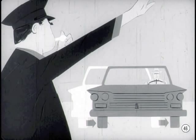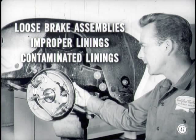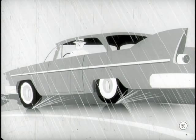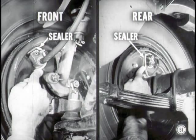Here's another condition that can fool you, and that is brake dive — a condition where the car will pull or dive to one side. First you'd naturally look for the usual causes, such as loose brake assemblies, improper linings, and linings that are contaminated by brake fluid or grease. But in addition, there are other conditions that cause diving, and they can be traced to loose or worn front suspension parts. Misalignment of the front suspension, such as improper caster and camber settings, can be contributing factors. There's also the possibility of moisture from road spray getting into brakes during turnpike and freeway operation, but that's hard to control because of the necessary running clearance of drums and dust shields.